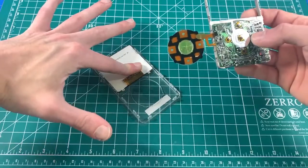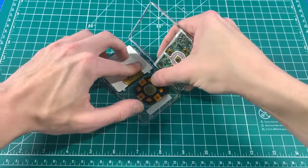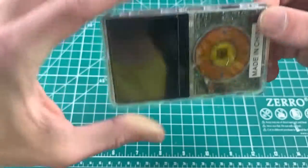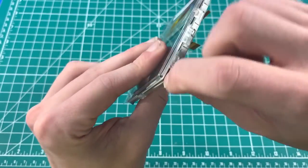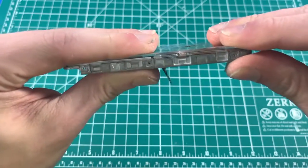Next, use one hand and one finger to hold up that LCD flex. Guide the click wheel and place the faceplate, making sure the screw holes are lining up with the midframe. As you can see, if I press it it won't go in — take a little piece of the midframe with your finger and sort of push it outside the LCD until it's lining up again.